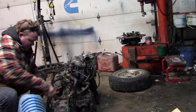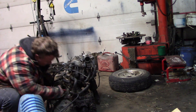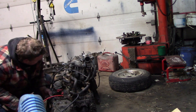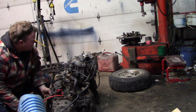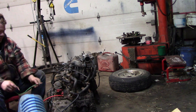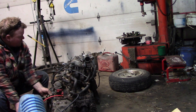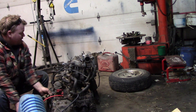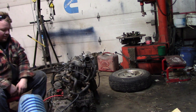I didn't have a good ground. Once I fixed the ground, we cranked it over to see if any water comes out of the block — and there's water in there. There's a lot of water in there. It looks like cylinder number three has the most water.